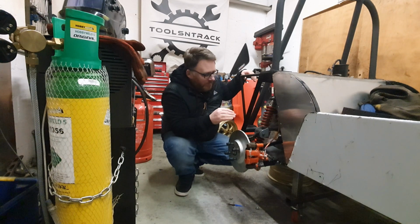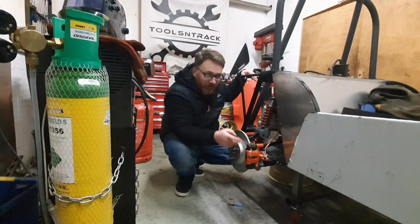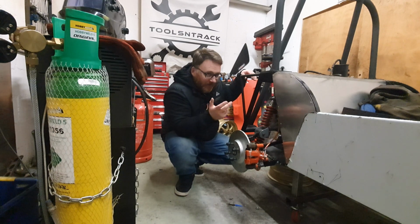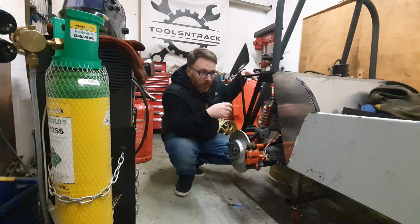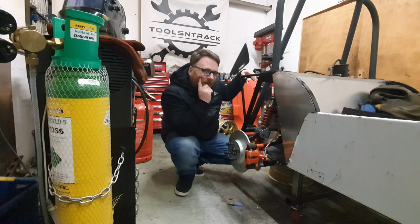Now don't ask me why Mazda made this decision. The backs are obviously not vented like the fronts are, but they are slightly taller. And the consequence of that is the calipers actually sit further up, closer to the wheel on the back than they do in the front. Obviously I've checked the fronts and went, well, there's no hope in hell that the back's going to be bigger. I didn't verify the wheels fit in the back.